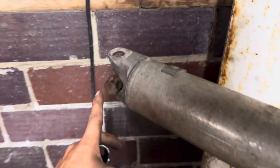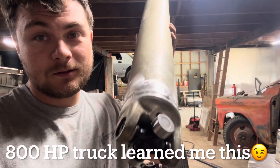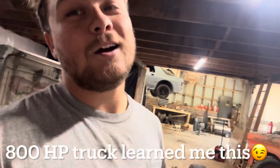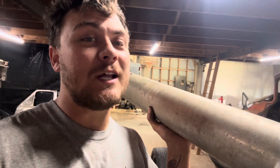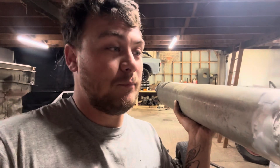On the other end we'll put the slip yoke back on. Since I've got this in my hand and I've got to flip it over, I'm going to prove to you that there's a golf ball in here to balance this drive shaft. A golf ball is one ounce, so as this spins, that golf ball should act as a balancing bead — it will go to the unbalanced spot and just sit there. Whether it actually works or not I have no idea, but we're going to find out.